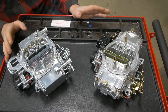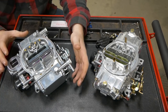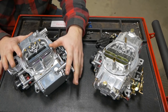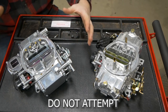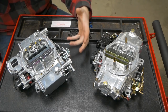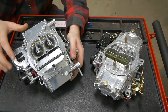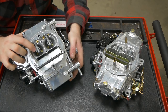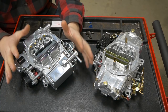For today I'm just going to use these as demonstration pieces to explain the difference between a few things I didn't really understand when I started out. Carburetors are a piece of equipment that allows fuel to be atomized into an engine. You can take a lit match and toss it into a barrel of gasoline and it will not ignite because the liquid form of fuel is not flammable — what is flammable is the vapor. So a carburetor uses venturis to turn that liquid fuel into a vapor or very fine mist. That's called atomization.